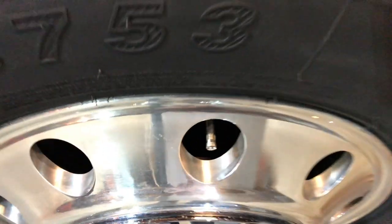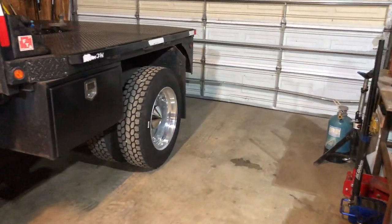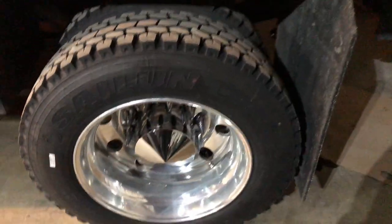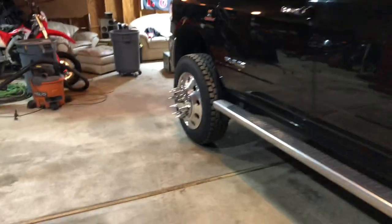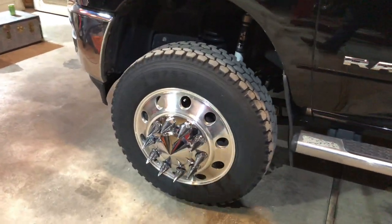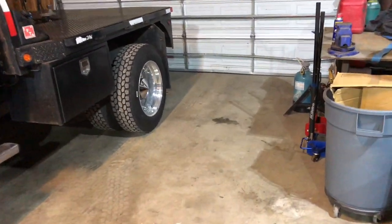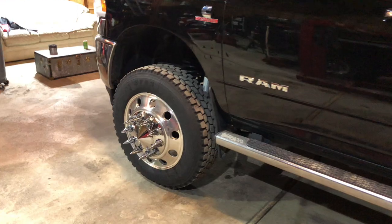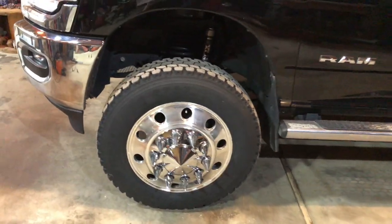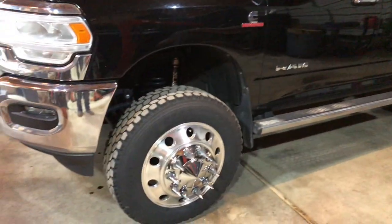The valve stem is going to be a TR554D — they're all steel. You don't get any rubber valve stems with semi trucks because they don't need any kind of failure point. You've got a couple different options with Alcoas: you can buy them used, which is what I did — mine came with tires already on them. If you're buying used rims and paying more than $160 a piece and they're not polished, you're losing money. Any good polisher is going to charge at least $100 a rim, so you might as well just buy Alcoa level ones with a perfect finish already on them.